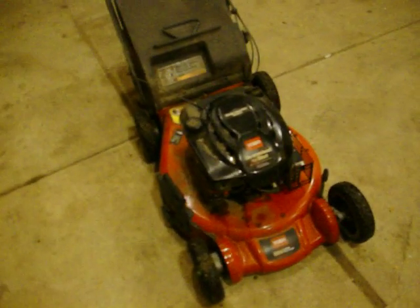Yeah, it could just be, what do you call it? Flooded. The engine could be flooded. But in this case, it's the air filter. I took it off, whole bunch of crap in there. There's grass, weeds. I mean, jeez.